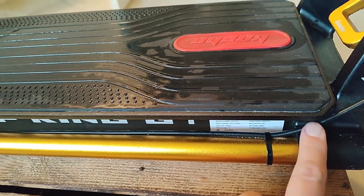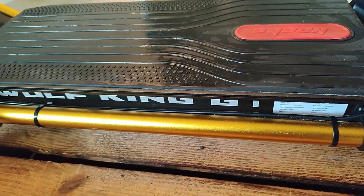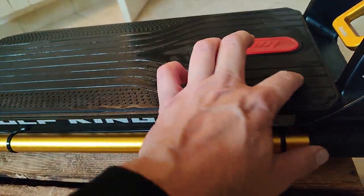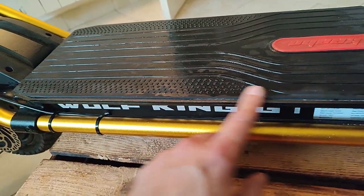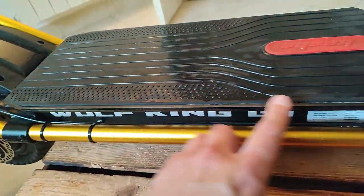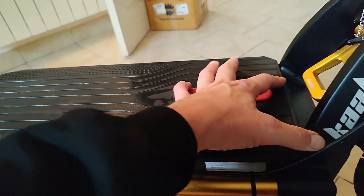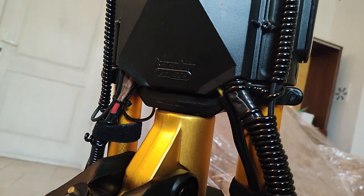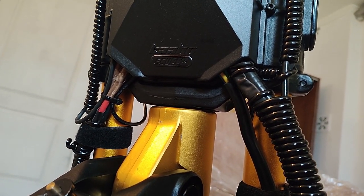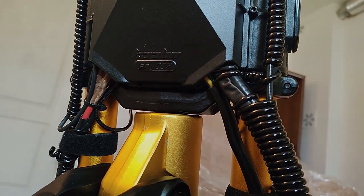As far as the gasket that goes around here, that does a really nice job of water sealing around the foot platform. So that is okay, even back here is okay. As long as your gasket is good, that's fine. But those two pieces up there and these two spots under here, those 100% do really well with silicone, and you'll have pretty much a waterproof scooter.